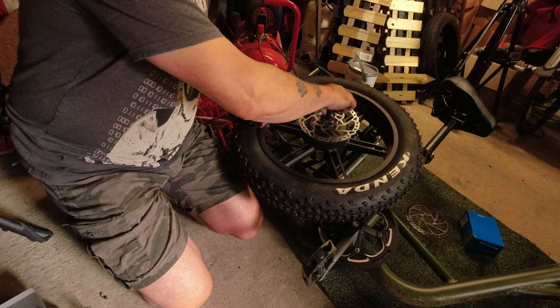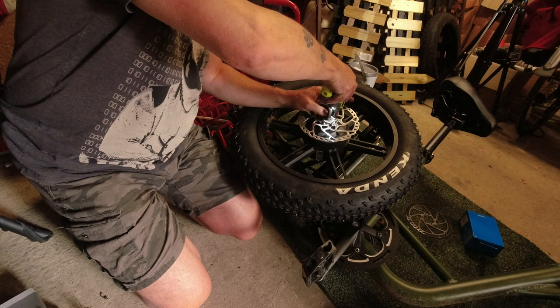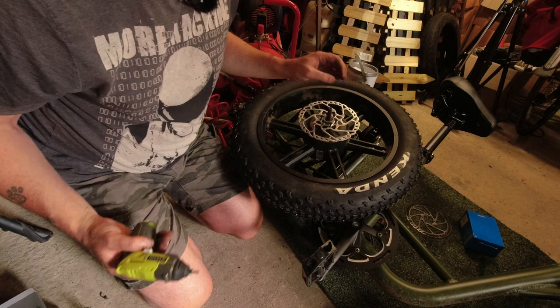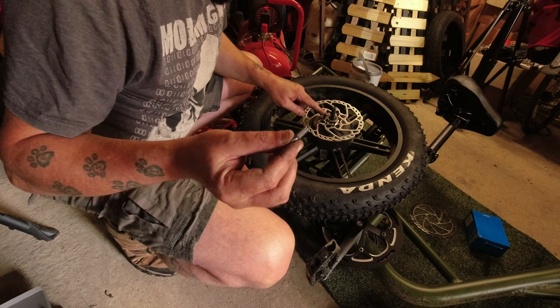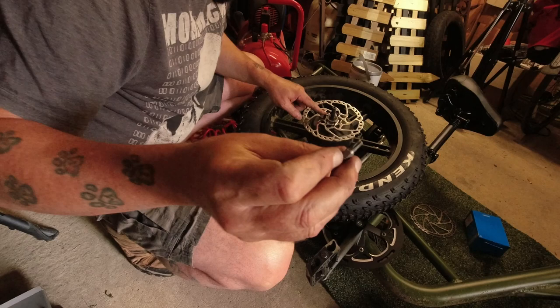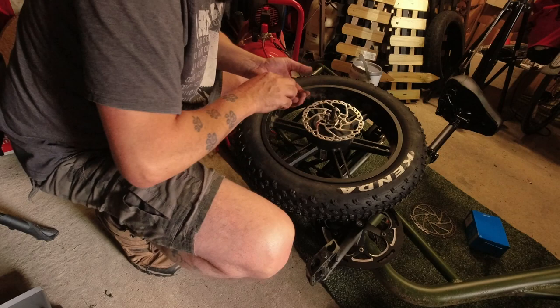Now, really, you're supposed to use a torque wrench for torquing these up, but I haven't got one. And there are differences. Ah, they're Torx fittings. Okay, they're not an Allen key, they're a Torx bit, which could be a nuisance if you haven't got one. I didn't notice that before. The screws take a T25 Torx bit, like a star shaped thing. Really useful to have. There are several of these screws on most bikes nowadays. So if you haven't got one, stick one in your toolkit.